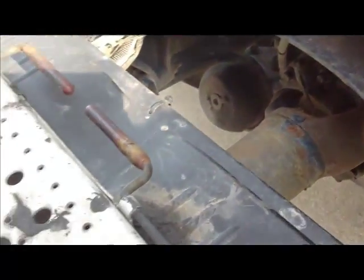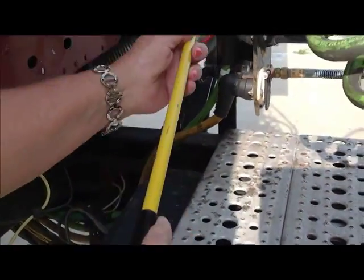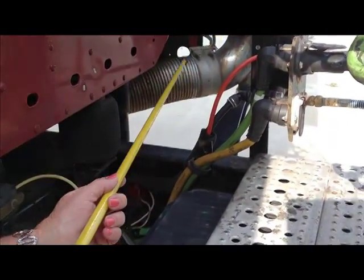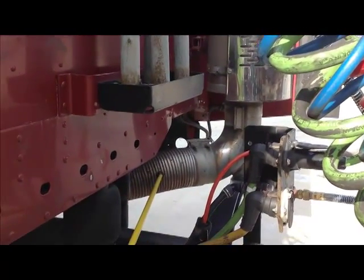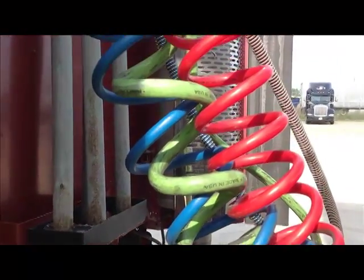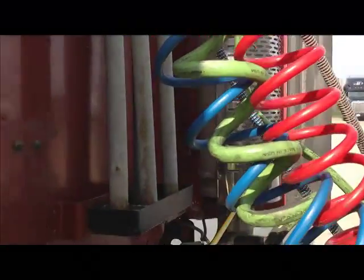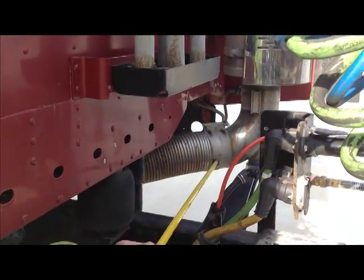Okay? While we're back here also, if you get this section of the vehicle, you will need to talk about the exhaust on this side of the vehicle as well. You will say the same thing you said on the other side, okay? But sometimes the DOT breaks your test up into sections, so you may not have the passenger side of the engine compartment. So you will say the same thing: the exhaust is securely mounted, not cracked or broken, no soot that would indicate a leak.